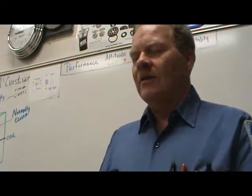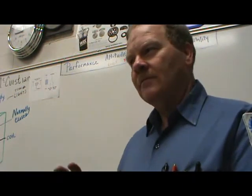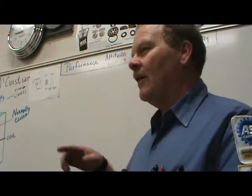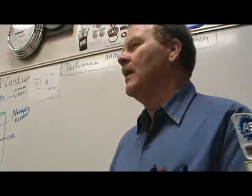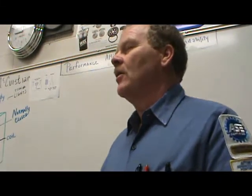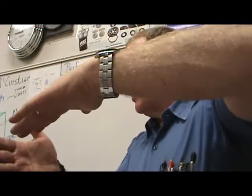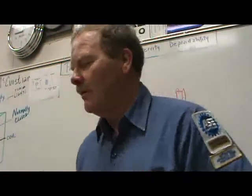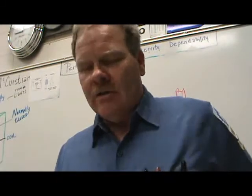So the smart thing to do is go ahead and jerk the torque converter out, replace the torque converter seal, spin the torque converter back in there, clunk, clunk, clunk, make sure it's all the way in, and then put it back together that way. But I've seen guys all over the place. They'll have that transmission drooping with that torque converter pulling down on that seal, because the seal, without it being bolted, is not being supported in the front. Make sure you keep that in mind.